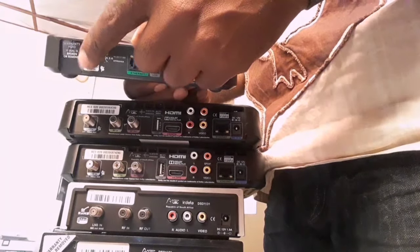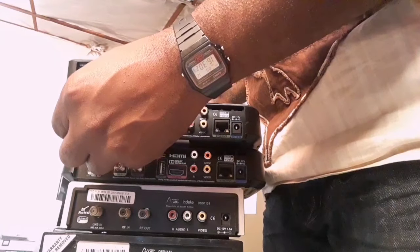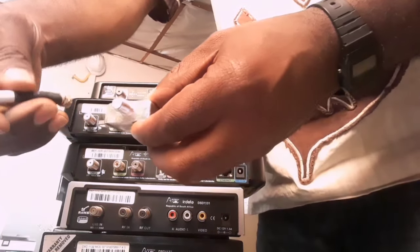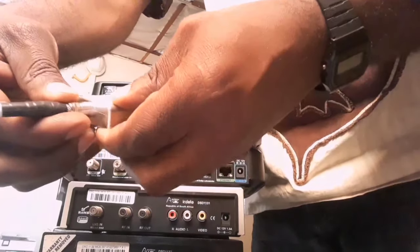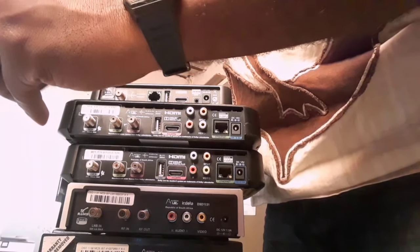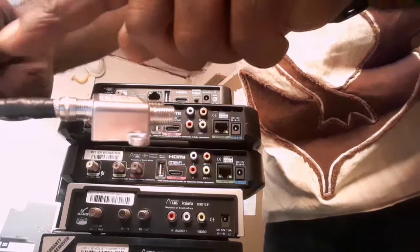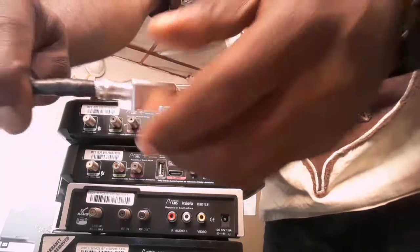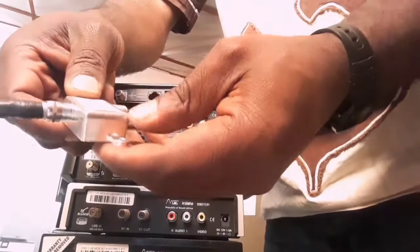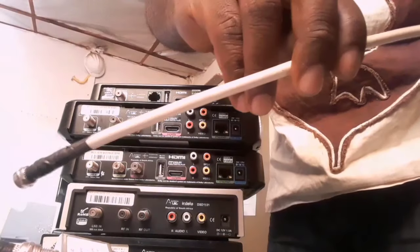So what we're going to do is use the diplexer. We take the cable coming from outside on the old decoder, put it into the 'IN' on the diplexer, and screw it in. The diplexer will help with communication because it combines the digital signal in one coaxial cable. After putting it in the diplexer, you'll see 'satellite' and 'antenna' outputs — the satellite output will go to the decoder.